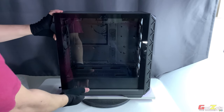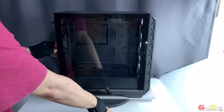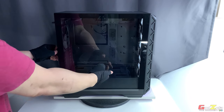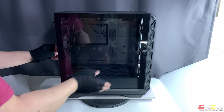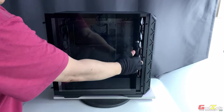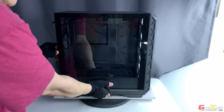Even when sliding the tempered glass back, make sure you support the bottom because if it contacts a concrete or stone ground it will definitely break. When removing, support the bottom of the tempered glass and glide it out. The same applies when placing it back — support it, guide it back, and fasten it in place.